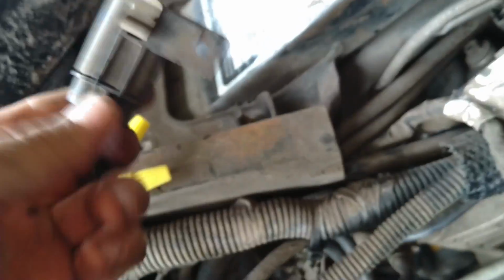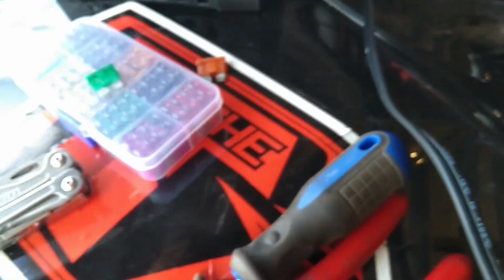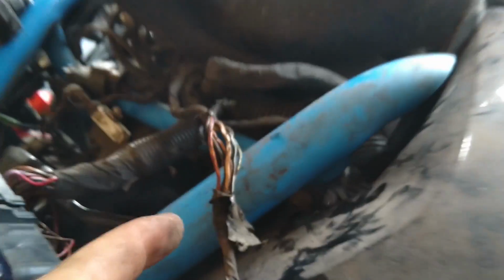And in addition to that, this fuse box, which is the fuse for the power steering, was full of water, and the fuse was so corroded that I'm just amazed my power steering was working. You can see all the corrosion in there. So obviously I cleaned out and replaced that. The fuse box is actually pretty well sealed. The relays are in the fuse box, which is one thing that they do better than Honda, where Honda's relays are not in a fuse box. So that's good, but this is pathetic.